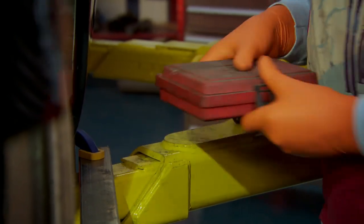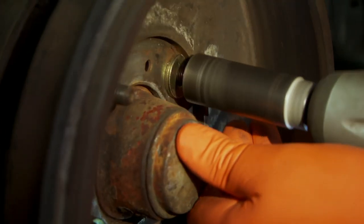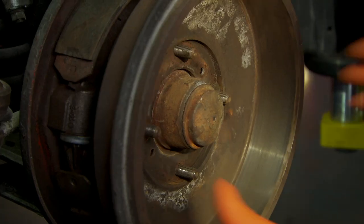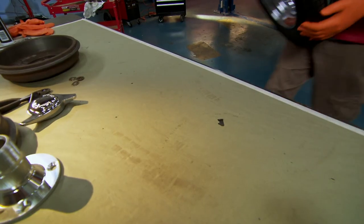So Mike was right — there is a fault, and luckily it's limited to a serviceable part. You can machine these drums on a lathe, or replace them, and that's actually what I'm planning to do anyway, because I have another MGA upgrade up my sleeve.